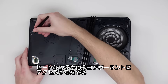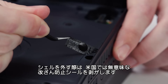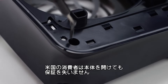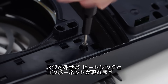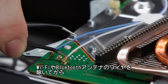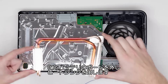To get to these heat sinks and the rest of the components, we'll take off this inner plastic shell. Part of this includes removing this tamper-proof warranty sticker, which actually doesn't mean anything in the United States. Thanks to the Magnuson-Moss Warranty Act of 1975, consumers in the U.S. can open their consoles for maintenance without fear of losing warranty coverage. And ten screws later, we have access to the heat sinks and inner components. We'll remove the wires running to the Wi-Fi and Bluetooth antenna connected via coaxial connectors, and also remove the CMOS battery board.